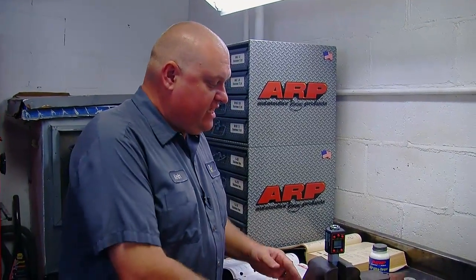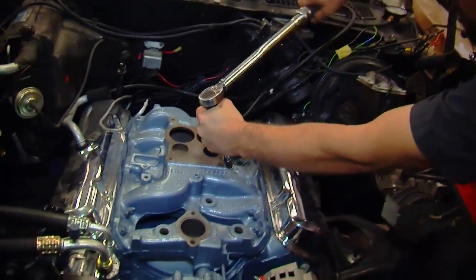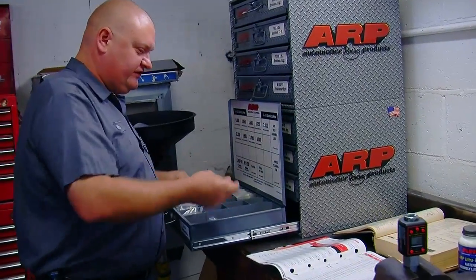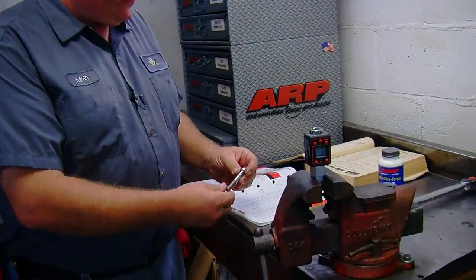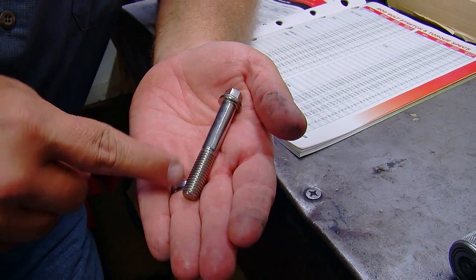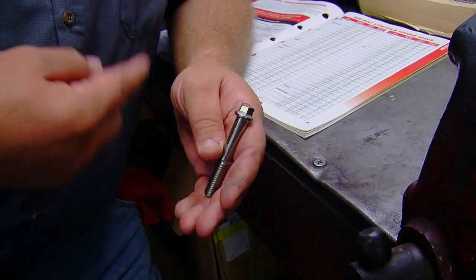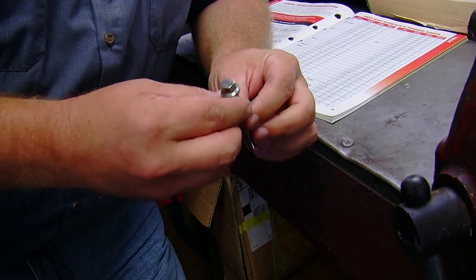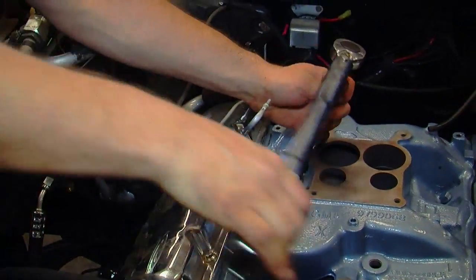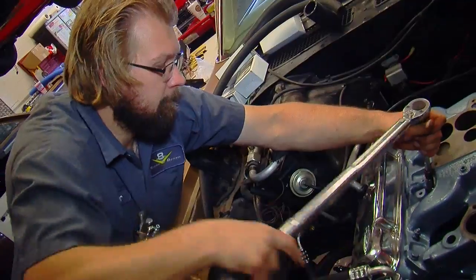Now we know we're putting 50 pounds of twist force on the fastener — but do we know if it's the right amount of clamp force on what we're tightening? Using an ARP 7/16 bolt as an example: the threads on the shaft are technically an inclined plane wrapped around the shaft. The more you turn it the more it pushes in, but making the correlation between turning the bolt and the actual clamping force isn't always consistent. As you're tightening a bolt you can measure how much twist you put on it, but you have no direct way of knowing the clamp force.